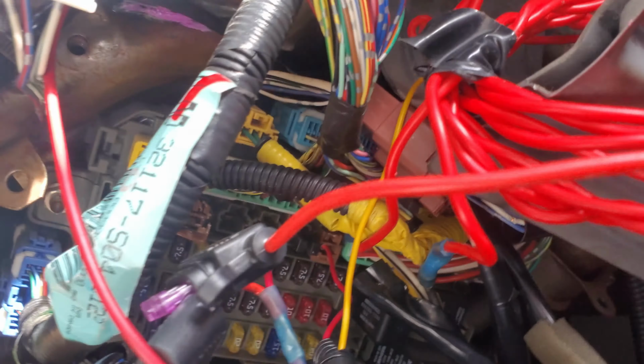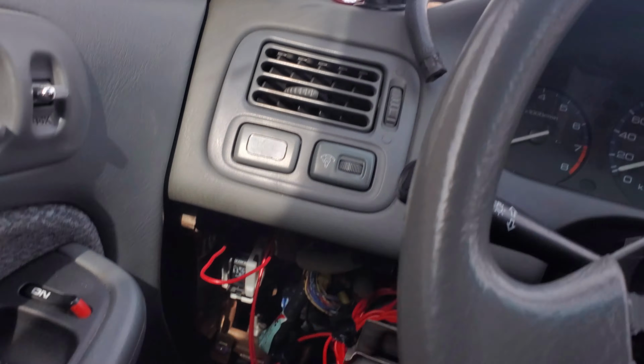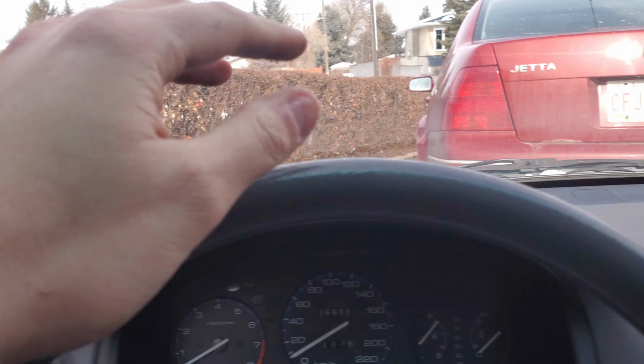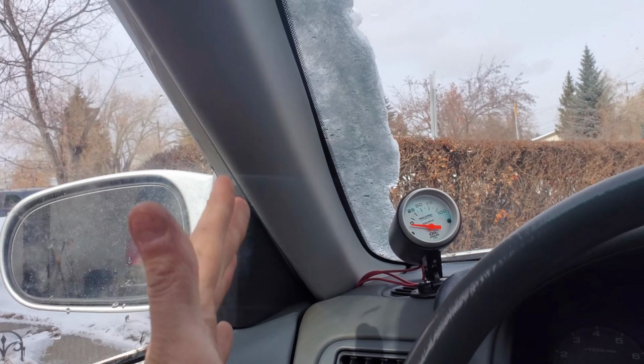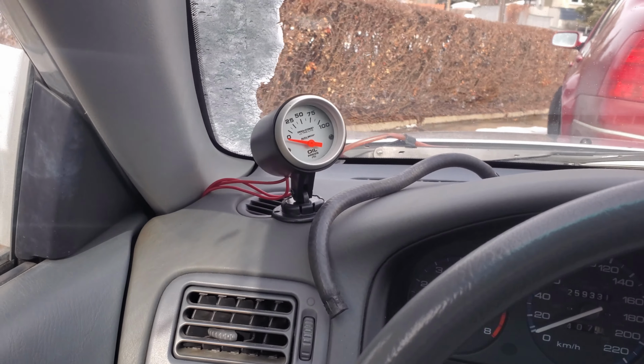12 volt ignition is going to be that lonely red wire hanging out. That one's going to be 12 volt ignition. I think the two to the left of it are both constant. So that's where I ran it up through there, quick and easy. Mount it wherever you're going to do there. Here, pillar, all the same. That's your wiring. And we'll go out to the sending unit.